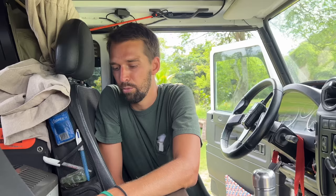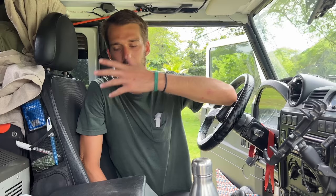Here is the diesel heater exhaust. The diesel heater is for when you turn off the vehicle in a very cold country like Alaska or Norway — you can turn it on via this console. It controls the heat level, acts like a heater, and takes diesel directly from the vehicle's tank. You can leave it on all night, set the temperature, and it just functions. You'll be in a t-shirt and shorts inside while everything outside is frozen.